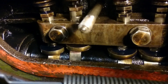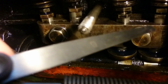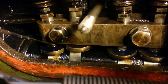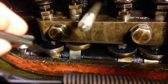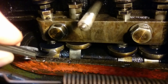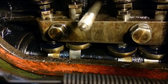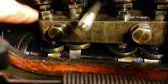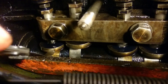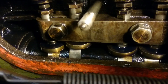I know that these should be four thousandths of an inch, and I've got my feeler gauge here which is a six thousandths one. So if I can get this in there, I know that the clearance is too wide. You can see it's gone in quite easily, so I know that tappet is set too loose. The other thing you notice with these cars is that they sort of make a rattling sound that comes and goes, so if you turn this round 90 degrees and try again, you might find it's tight - and it isn't. So I'm pretty sure that this tappet is too loose.